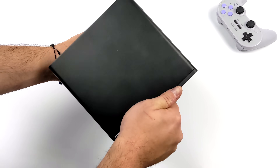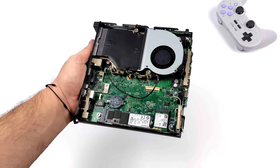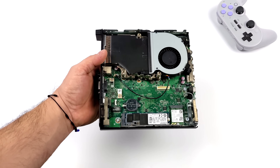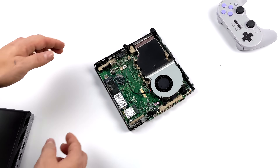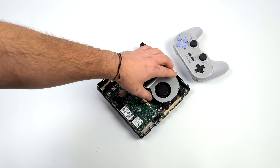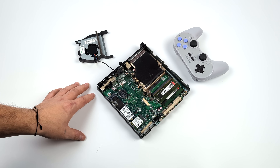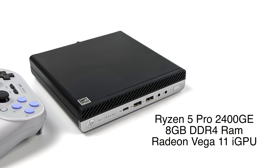If you wanted to, you could go with Windows or a different version of Linux and install your own emulators, but Batocera has everything we need already built in. You can boot it from a USB drive, a USB hard drive, an internal drive, or an M.2 drive. With this setup, I've got it installed on a 256 gigabyte M.2 SSD right here in this Elite Desk 705. We've also got 8 gigabytes of RAM running in dual channel, and this is very important when it comes to these APUs — you definitely want two 4 gig sticks. For emulation, 8 is going to be plenty, and it also keeps the cost down.